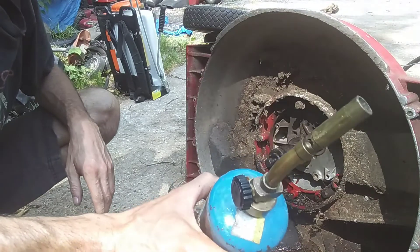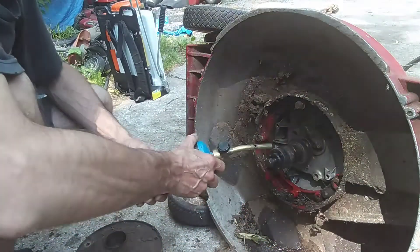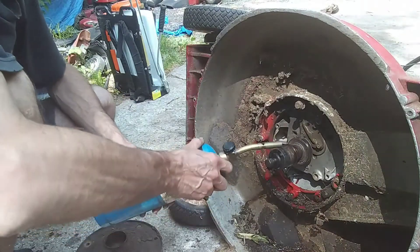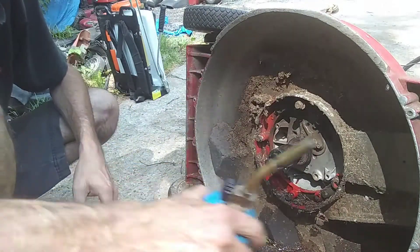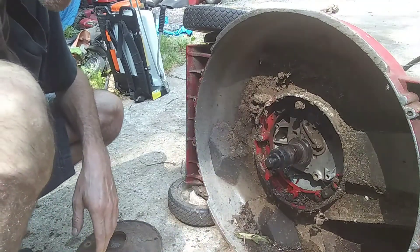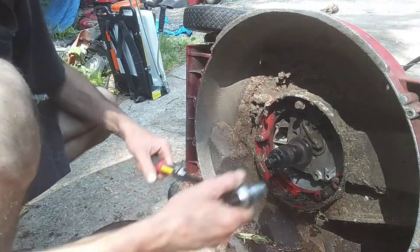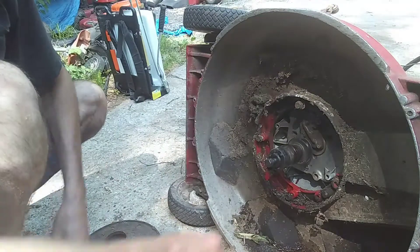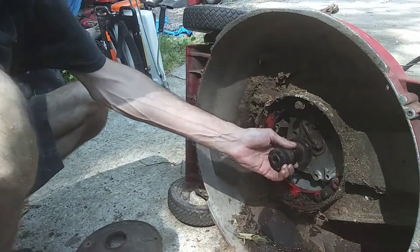I came out here today and I heated it up with my propane torch, got it real hot — it's not going to get cherry hot, but you heat this piece up really good. Then I quenched it with some water — the old quench trick. Fortunately this one didn't give me a lot of trouble. After I had that, I just cranked on my socket and it came loose.